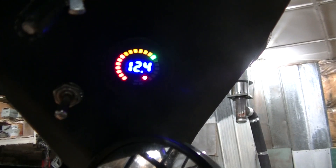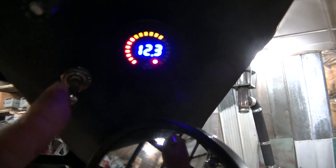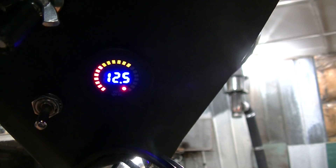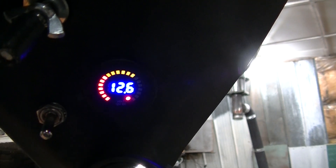I put in a voltmeter — see if I can get a shot of that for you. So if this was running and I hit this switch here, it will come up to 14 volts, 14 and a half, whatever. That works well for me — I can charge the system without revving it hard while it's still cold. Zeke the antique freak, over and out.